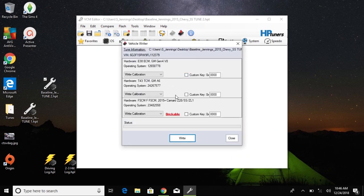Now we're gonna be writing to the vehicle. You'll see it's looking for my VIN, it's got everything, and you just hit write. From there it's going to start writing everything — the car is going to start making noise. Right now it's erasing all the old calibrations and installing the new one, so it's going to take a couple of minutes.